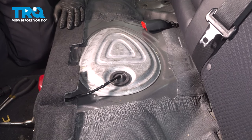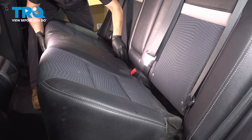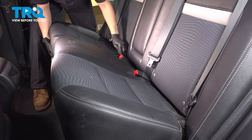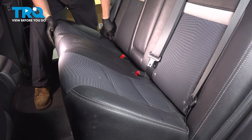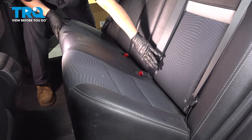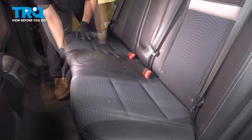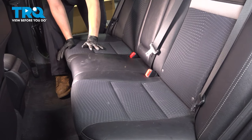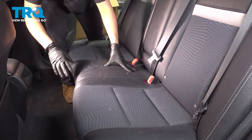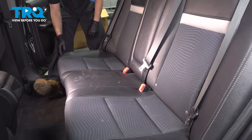Let's put the back seat on. When you put the back seat in, make sure you get the seat belt latches through their corresponding cutouts. Slide the seat in — sometimes you'll need to forcefully push it down into place. Make sure the seat belts themselves are not getting pinched or caught. Once you get it close, it should pop down into position and clip in. Let's start up the engine and make sure it runs. Put the fuse back in, take your fuse box cover, line it up, and snap it down.